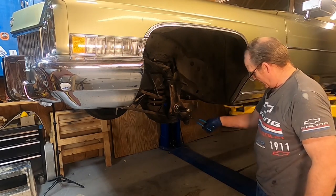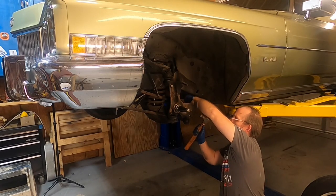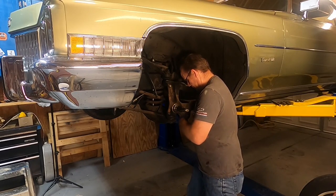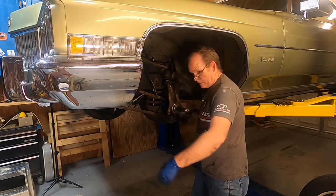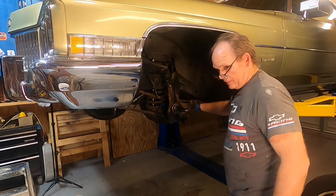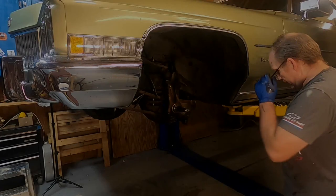We can actually see the nut now. Let's straighten out our cotter pin. Sometimes I take a pair of needle nose and slip one side through the loop on the other side of the cotter pin, hold it with one hand and then tap on the pliers - that works sometimes. We used various methods - banging and crushing and twisting and cussing. There's one piece of cotter pin, and there's the other. That's 11/16ths so that's going to be a three-quarter. All hail the air ratchet - we'll get a new one anyway.